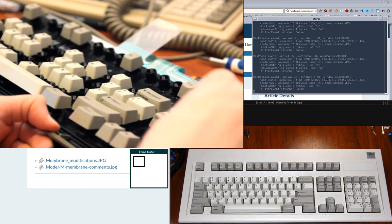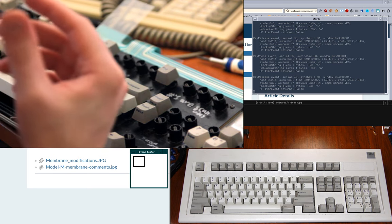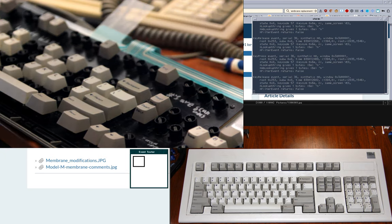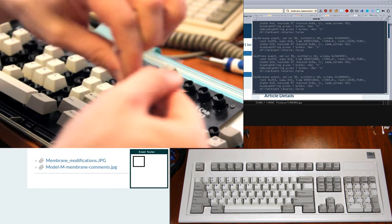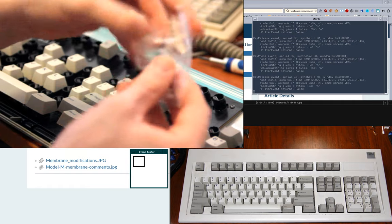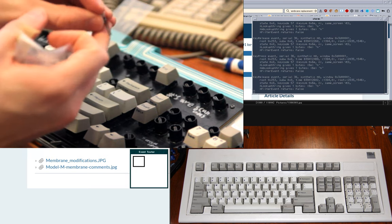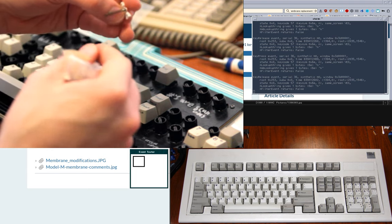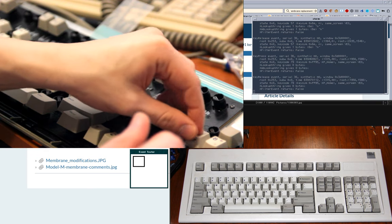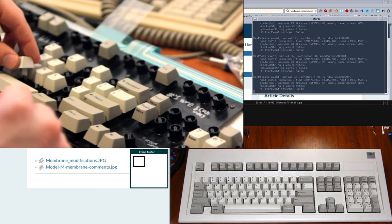And yeah, I'm testing each key a couple times when I put it down. I think the 7 key was a tricky spring key, like I mentioned, and I think that it's because the rocker piece itself, where is my bag of those things? Here it is. So the rocker piece itself that pivots back and forth, I think where the spring connects to that, like I had purposefully bent the spring near the end of it, like where the peg is here that hooks onto the spring, so that it came out of the spring at a weird angle. And I think I had to do that to make it work right for the 7 key. And the 7 key is what I'm about to put in, so we'll see if that holds. Perfect. Okay. Yay.